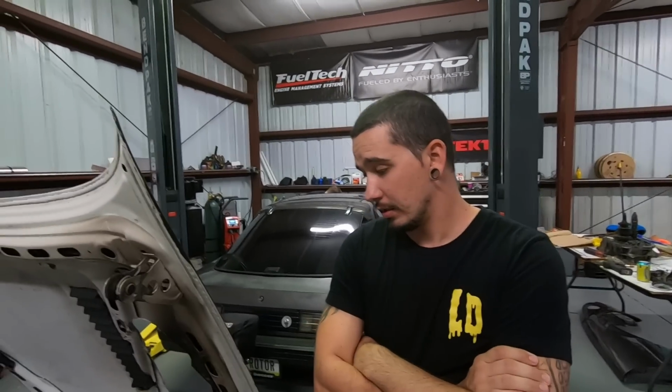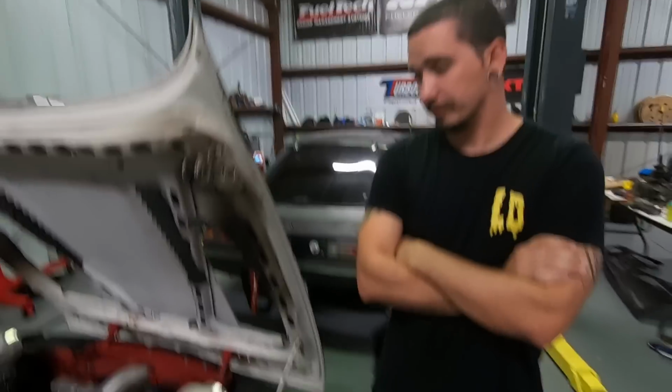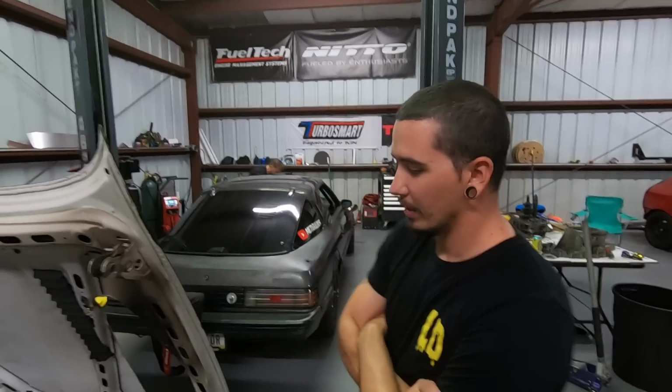Kind of like it though. She rips. You definitely feel it. We did a 5th gear rip on the way home, and man, it puts all of that down. But the gates are doing good. The gates keep it at 8 psi. They're fine. Pretty surprised for as bad of a flow priority as they have, but they can keep it right at 8 psi. Chinese choo-choo boys, pretty decent, not bad. But anyway, that's where we're leaving off.